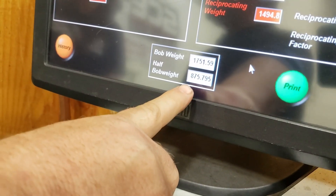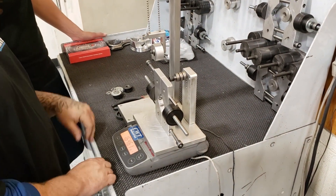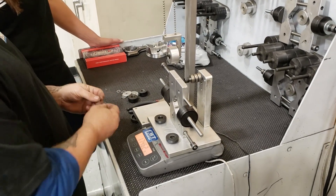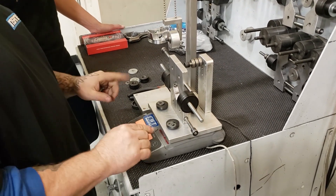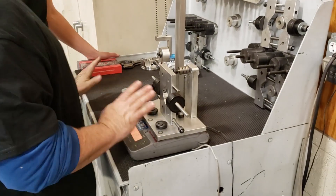You're never going to hit that number exactly, but we're going to get really close. We take the weights supplied by CWT — we're at 1,646, then adding weights we get to 1,746. Whatever we put on one side, we need to put on the other side. We got 51 on the dog. We could put a half-weight on it, but there's no reason.